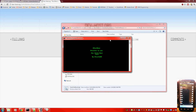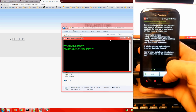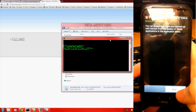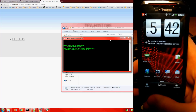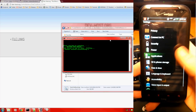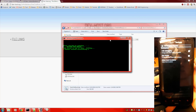Right-click and run as administrator. You're going to have to watch through this little ASCII video. It looks like we're actually going to be required to set up the phone — you need to enable USB debugging. Go to Menu > Settings > Applications > Development > USB Debugging and give that a check.